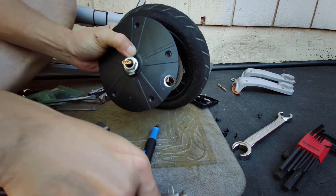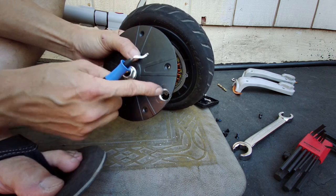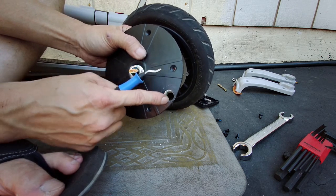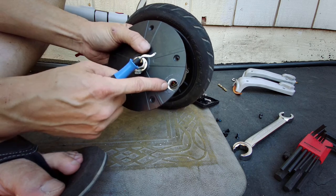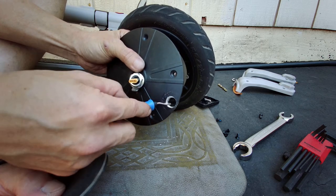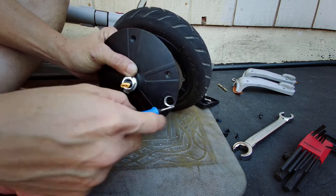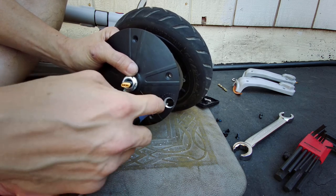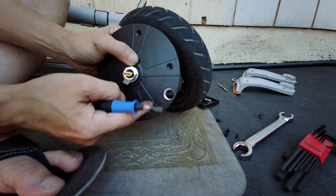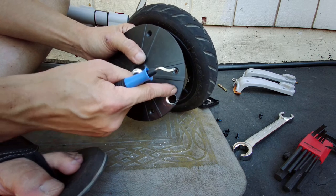Every once in a while I'll test fit the head here and make adjustments, because sometimes when you bring this out your pressure isn't uniform and some spots might be more shaved off than others. So you have to look at that — if this spot is more shaved off, now you have to avoid that and focus somewhere else. You're basically just focusing the pressure. Don't put too much pressure into it either, otherwise this little tiny plastic piece right here will break. I wish they'd done this at the factory — it's cast and then machined, so they should have just added that one extra step to machine this out a little bigger.